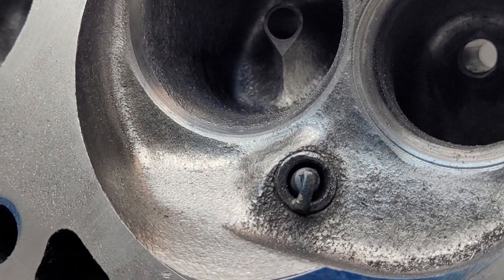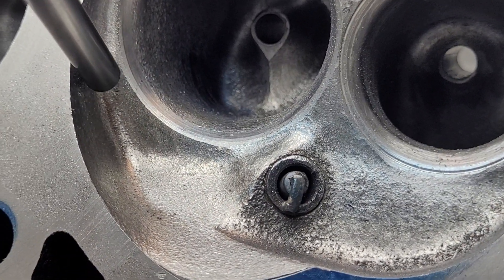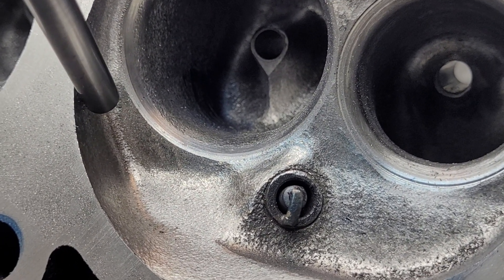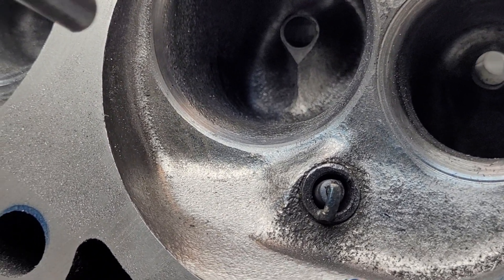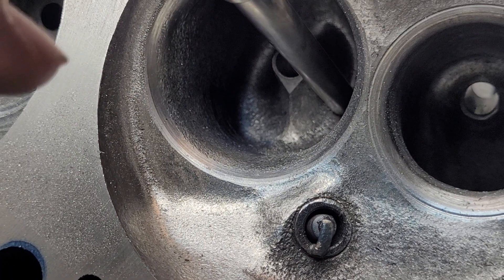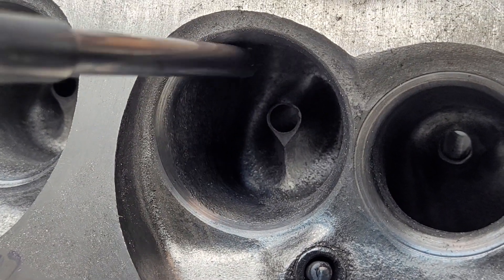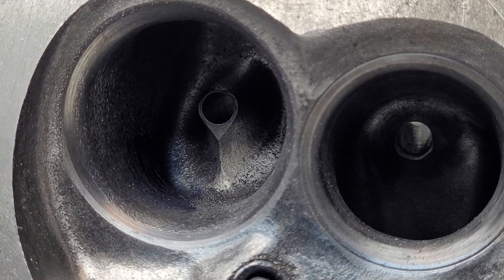When the air is coming out, it kind of has a nice way to swirl around. We're trying to take pressure off of this side of the port, giving it an easier way to exit. That'll change our speeds inside and it will change our speeds on the short side radius — remember the short side radius is super fast, so we need to reduce that.